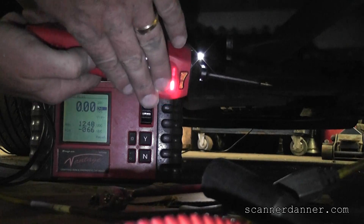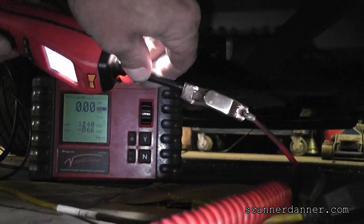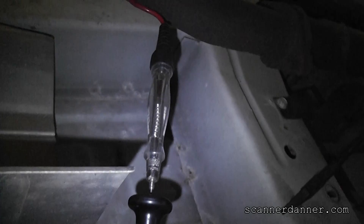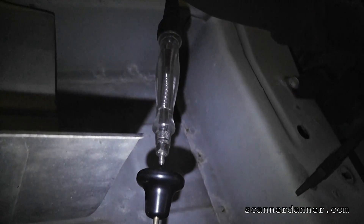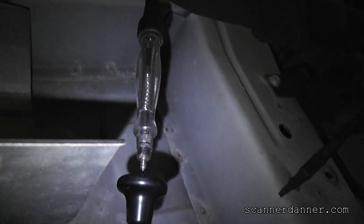You see the red light — that's going to be my power feed. I'm going to take my test light to the end of my power probe. My test light lights when it finds a ground, and my test light is connected to battery positive. I am not putting power into this control circuit with the power probe — if I put power in this circuit and then turn the driver on, I am going to cook the computer. You need to know what you're doing using this tool, same as with a jumper wire. Be careful. I am using my power probe as my test light's power feed.